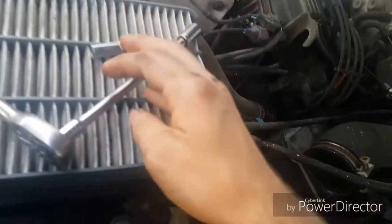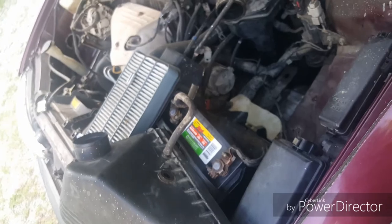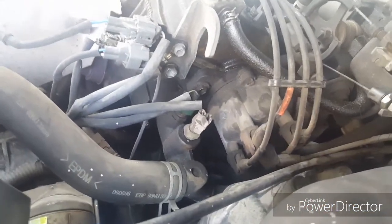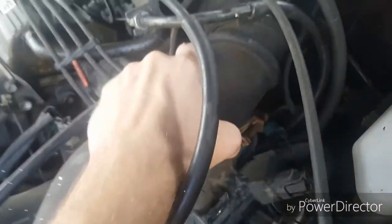For the air intake, I'm going to go ahead and loosen that up. It's whatever side you have at the time — five sixteenths or eight millimeter. Make sure all your vacuum lines and things are out of the way. There we go, it goes loose and it comes off.